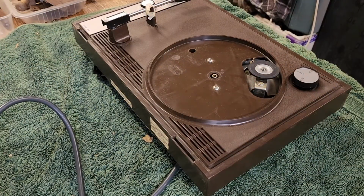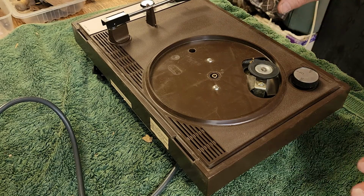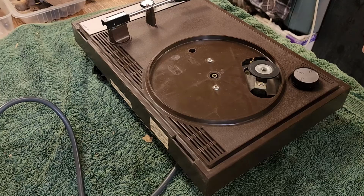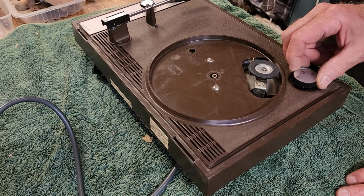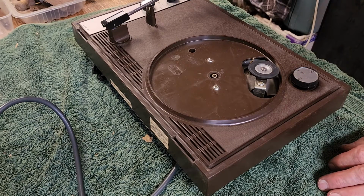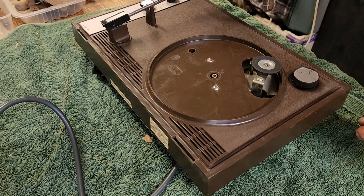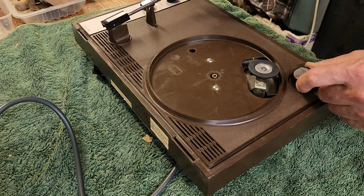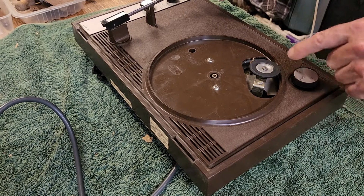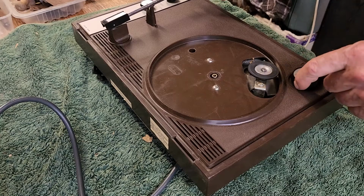The case is now screwed back together, and we can take the tape off the tone arm. And now, before we put the turntable platter on, let's just see if the motor spindle works. Let's apply some power. We'll go to 33. And we'll go back to off. And we'll lift the tone arm up and we go to 33. Really nice. That actually sounds a lot more quiet than it was. Looks to be driving on the right part of the spindle. Let's go to 45. Drops down a little bit. Oh, it's jamming on the side of the plastic case, so it's not going to turn that. But it seemed to have a fair bit of torque on the rubber.